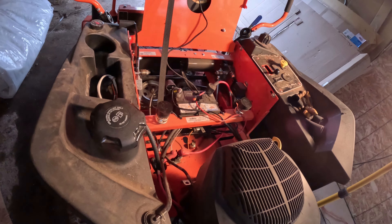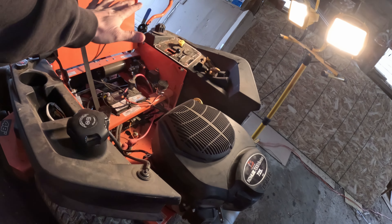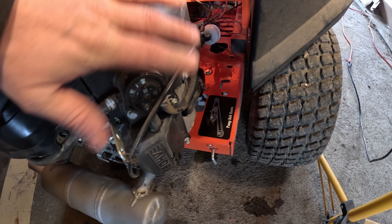How about fuel? How are we going to see what fuel problems we've got? We get these machines in all the time — people want me to do all sorts of things like change out their fuel pump. It's not your fuel pump. They tell me they filled the oil because they thought it was low, and oftentimes these machines come in with the oil way too full. If a lack of oil is the reason your machine won't start, the engine's toast. Make sure you have oil, but it's not oil — it's fuel.